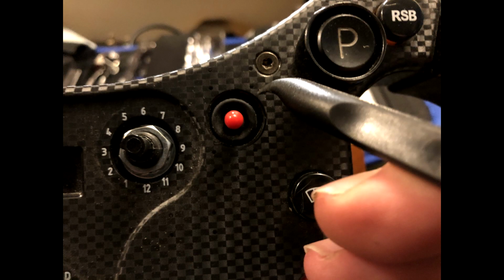The red rocker switches have little rubber covers which just pull off too. I used a plastic hook tool from a cheap electronics repair kit that I bought from Amazon. You can use a fingernail, but don't use anything too sharp and puncture the rubber. Just ease it gently up and off. It's held on by the smallest part of the rubber being below the red covering of the switch, but it slides up easily over that.